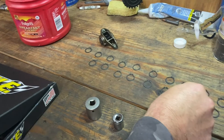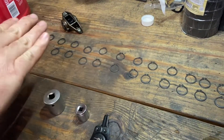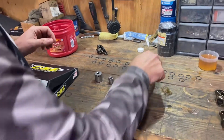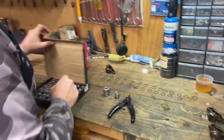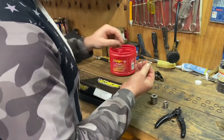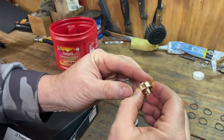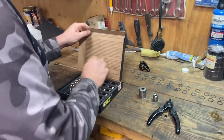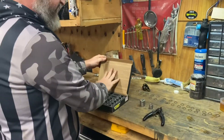You just want to make sure that when you orientate these, when you get ready to put them on, that your rough edge — I do it where the rough edge faces me, where it's facing up. That way, when I get ready to put the snap rings on, you want that rough edge away from this bushing. So you don't want that rough edge touching this bushing. That's what the instructions say. Be sure to read the instructions.